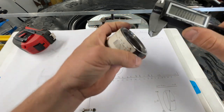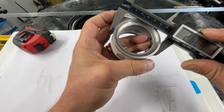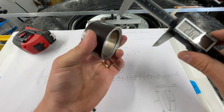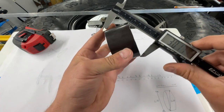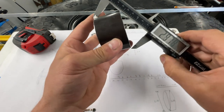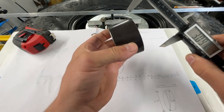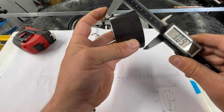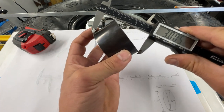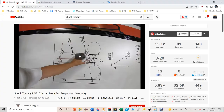On the uniball, it's important to measure how big this part is — but realize the uniball is part of the A-arm, not the spindle. You really have to measure the widest it could possibly make itself. In this case it was about 3.02 inches wide, and that's what I have to account for as it rotates left/right and up/down in relation to the spindle. I'll use about 3.25 inches to give myself some slop so it has room not to contact the spindle.